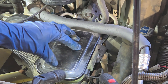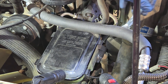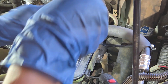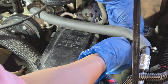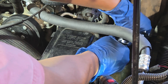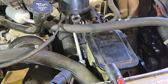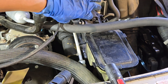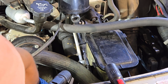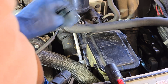Disconnect the master cylinder from the Hydro Boost — two nuts hold it in place. Use a 13 millimeter wrench to hold one side, then come in with a 15 millimeter to remove that nut. On the other side, same deal: hold the stud with the 13 millimeter wrench and come from the bottom with a 15 millimeter socket and 6 inch extension. The AC line is not getting in the way — plenty of space.